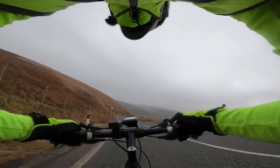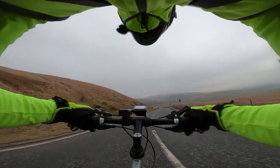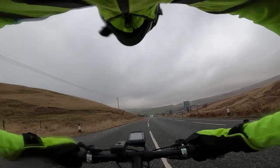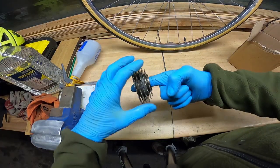I tried to do 40 miles per hour on it. Now this is a 10-speed bike, but on the back it's got a six-speed block, which means it's for a 12-speed bike. I found that at 30 miles an hour I was absolutely spinning flat out, so it needed a five-speed block on the back.